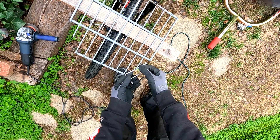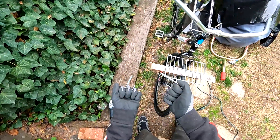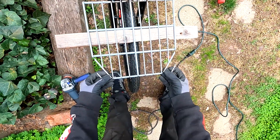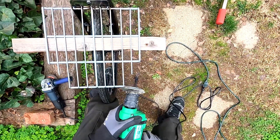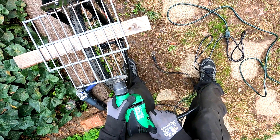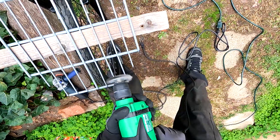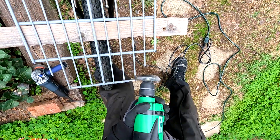Unfortunately these little pieces that I cut off of the front to make it look more streamlined and tapered aren't long enough to span the gap I just made, so I'm going to have to get a little creative — cut some pieces together and form a longer route that I can weld to the front. This change is completely cosmetic; it doesn't really affect the bin or anything, but it does make quite a big difference in how it looks. It was just looking too boxy — I wanted the front to be more integrated with how the rest of the bike was flowing, and I'm glad I did it.